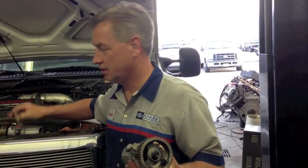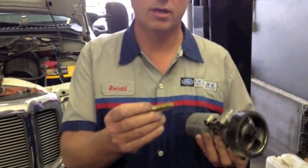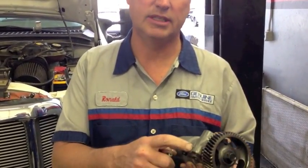A question people ask is: can I tap it out? Yes, we have done that before. We've used a quarter-inch pipe thread, went inside there, tapped it, plugged it, and it's worked. I've done two — one worked, one did not. It still started, but the IPR would go to 85%, so the pump was weak. It's up to you if you want to take the chance — you may just end up doing it twice.